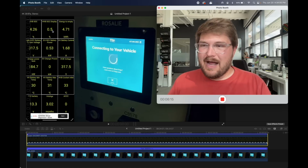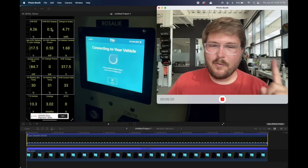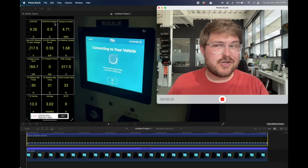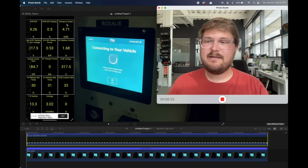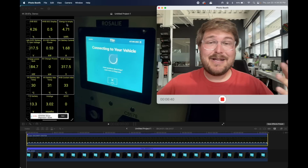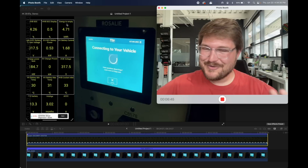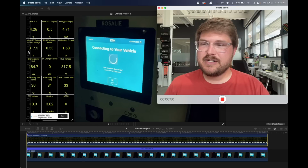So basically, I always plug in the trucks or cars on a charging test as soon as it dips from 1% to 0% state of charge, and that's exactly what we've done here, and that's user displayed. There's about 4.7 kilowatt hours left in the battery pack according to this energy to empty right here, and it seems to cut off at about 2 kilowatt hours. So there's still a buffer that it won't let you go down. And I found that out during the range test when I ran the thing out of charge, which was hilarious. And if you haven't seen that video, it's great. A viewer came out, we were pushing it. That was just awesome.